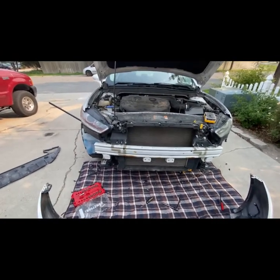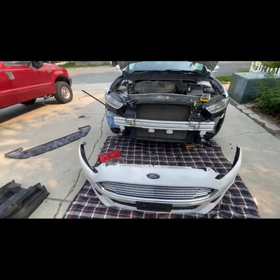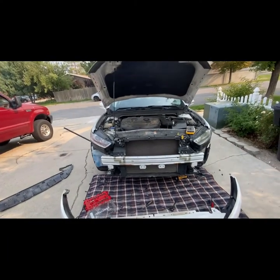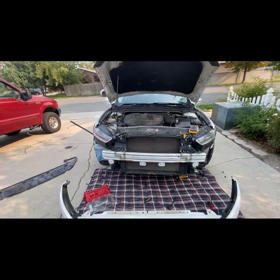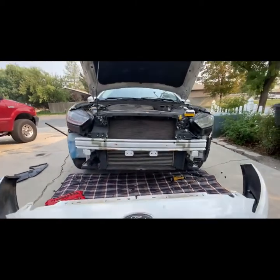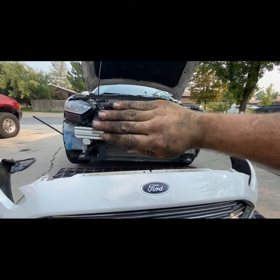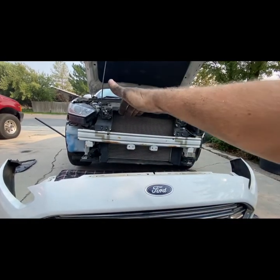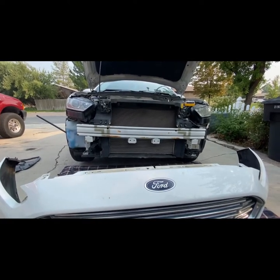Let's go over the reason why it would be like this. It's really for one reason: fuel efficiency on an economy car. What they're designed to do is when you're driving in the city, your fan is electric and always going, so they stay open. When you get on the freeway, they close — covering your radiator and intercooler — and it relies on air coming under and over the engine to cool it for more fuel efficiency.